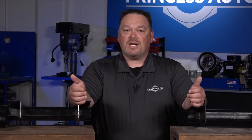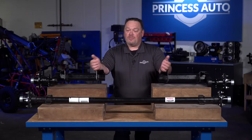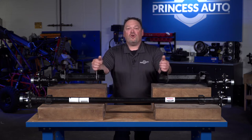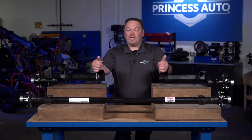You have different options when it comes to axles. Here on the bench we have what's called a straight axle — they're not actually straight, but we'll get into that later on. They have a connecting tube from end to end, and you would have that underneath the trailer.